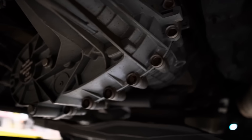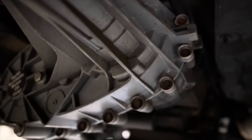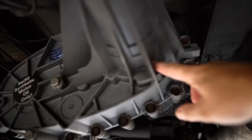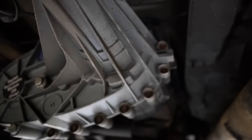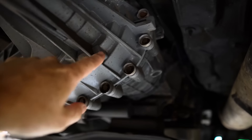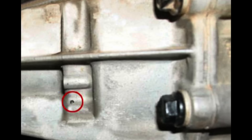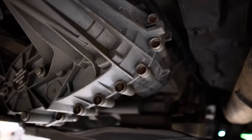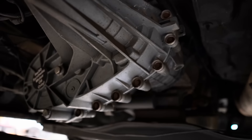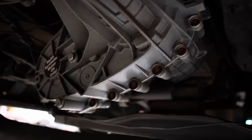I'm going to do a video at Kodiak Truck at the business there and show you guys what it looks like when it's all torn apart. The lighter parts on the back end of this case is where the pump actually rides — that's where it sits. Eventually over time and many miles of it rocking left and right, it's going to eat a hole into that case. You'll have no idea until it's too late, and then that transfer case is probably going to end up exploding, breaking into little pieces, and you'll have to buy a brand new transfer case.